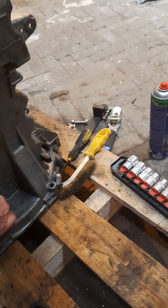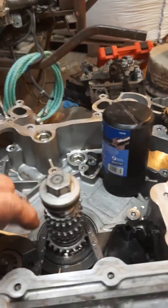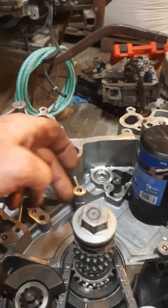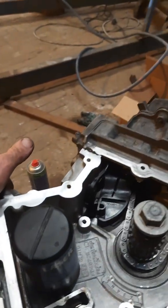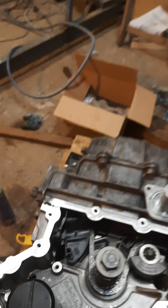There's also alignment on the crankshaft — a marking on the crankshaft sitting directly at 6 o'clock, and the keyway also sits at 6 o'clock. All of these parts seem to line up correctly, apart from the chain issue. Anyway, if anybody has got some ideas, I'd love to hear from you — thank you.